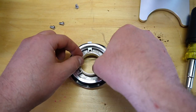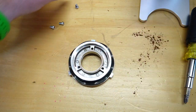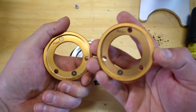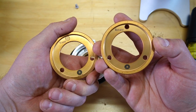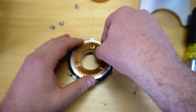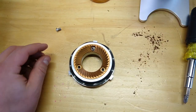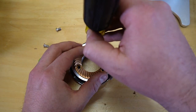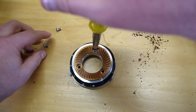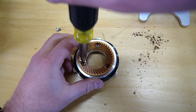You're going to want to put this rubber O-ring back on — it does kind of want to flip or roll off. This is your fixed burr, and note on SSP, there is a rotary and a fixed; we're going to use the fixed burr. We're just going to gently put it in there and throw these screws in. Let's do one at a time. I typically like to get my burrs pretty close and then tighten them in a circle.